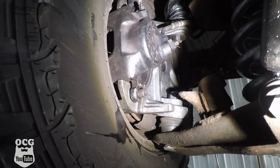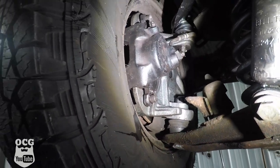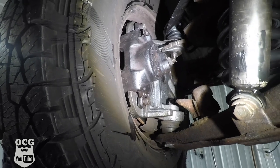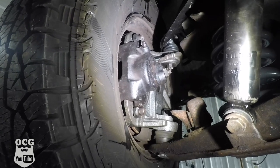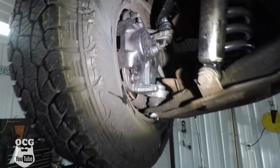Also, you can see some wetness on that caliper — the brake hose seems to be leaking at the fitting. When we were putting this on, I did have to bend it a little bit to make it fit around that spindle, and I think what we've done is weakened where it mounts into that banjo fitting, so we're going to have to replace the hose. Some of you probably already know that I've got hoses all ready to replace on this thing. It was one of those things I wanted to wait until I got it out to the shop, so it's going to be a project we'll do while the truck is out here — probably over the next couple of weekends.